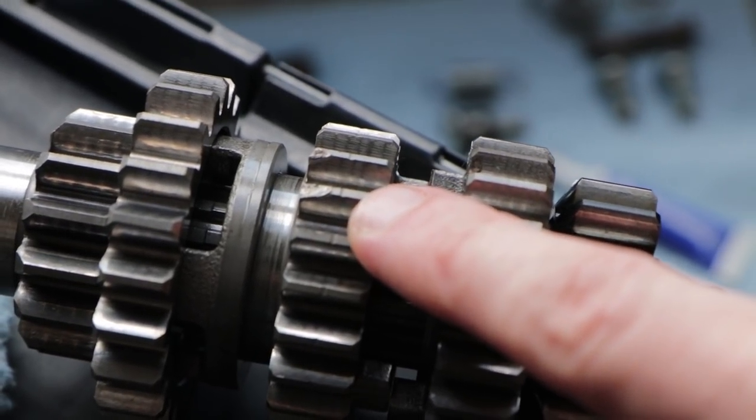Finally, with another YZ Supermoto build video, and hopefully today this will be a chill project, but I'm not counting on it because everything I take apart from this bike is just a mess inside. It's also why we're not rebuilding the engine in this video, which I had already started, but I ran into an issue. One of the transmission gears actually had two chipped teeth, so I had to order a new replacement gear, and that takes a few weeks to get here.